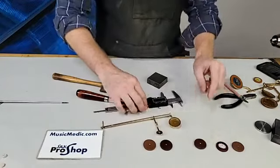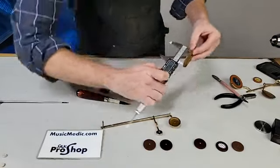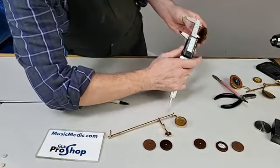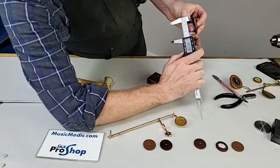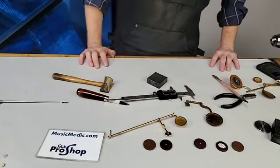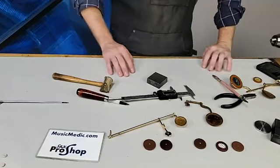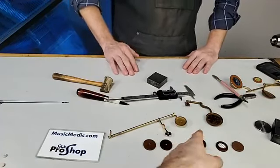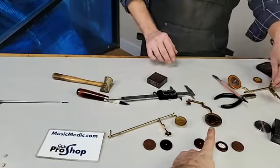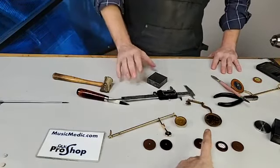But again, the biggest thing when you're measuring, hopefully you are measuring, is that you've done all the prep work. This one right here is measuring 45.56. Again, that's north-south. Let's do the east-west: 45.38. That's pretty close. So now you've got 45.38 and 45.56. We've got 0.2 millimeters difference, so it seems like this is going to be a 45.5. But if it measures 45.3, tell them about rounding and how we do that.